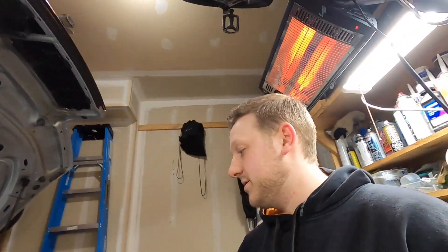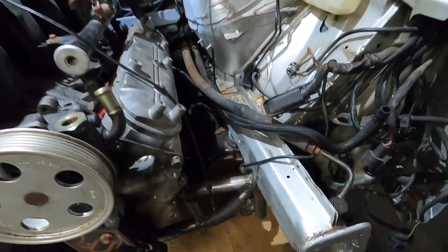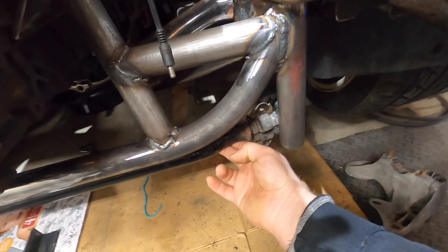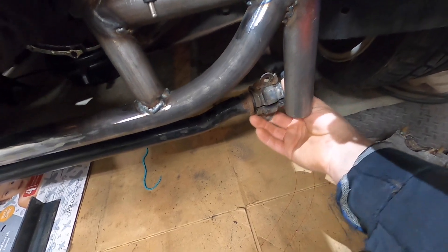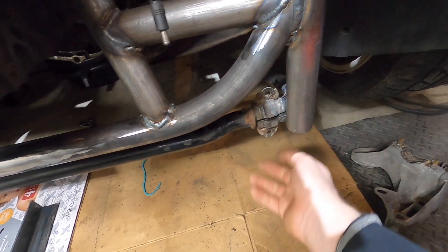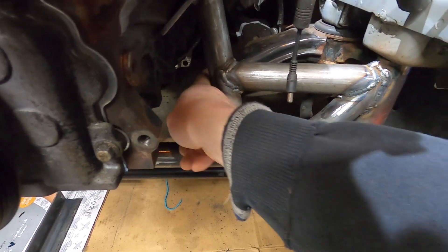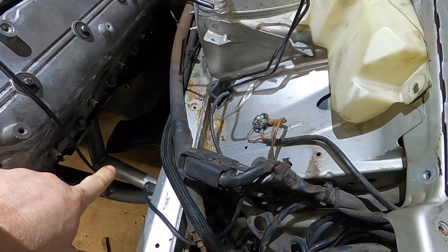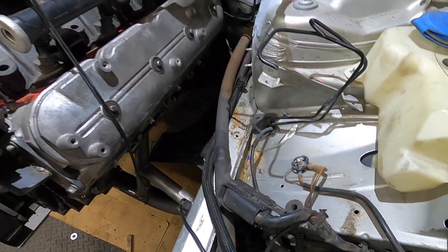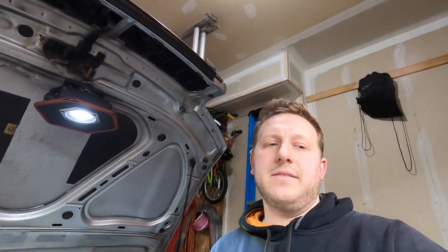That's good news, hopefully that works. There's still the sway bar mount to figure out - I'll get some mounts with a flat backing plate for the diameter of the sway bar, weld in a flat piece of plate and put some nuts on the back and bolt it right up. We still need to get this subframe brace done because it does move a little bit and it will strengthen the mount more. I'll have to take a look at my list and see what I'm doing next. Don't forget to like and subscribe - I'll see you in the next video.